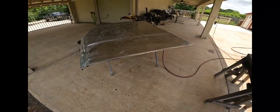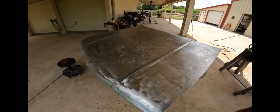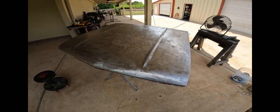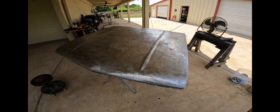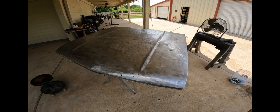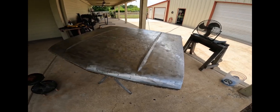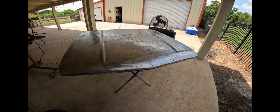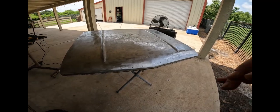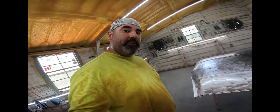So it's noon, and what I'm going to do now is wipe this thing down with the alcohol-based wax and grease remover, let it sit for about half an hour, then grab something to eat and come back and spray epoxy. I got 24 ounces mixed up. It's been mixed for about 3 hours. Let me get this wiped down, moved inside the little paint room, and I'll bring you guys back. All right, so it's been about 40 minutes.